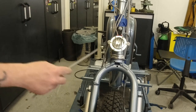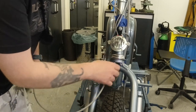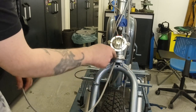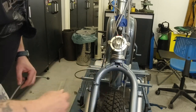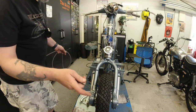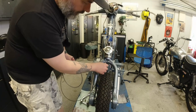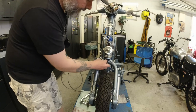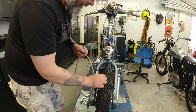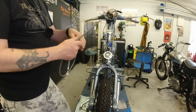The first thing I do is check that the outer actually goes through the hole in the fork, which is here on the leading edge — and yes it does. If it's a bit tight, maybe newly painted, you can put a little needle file in there to open it up. Next job is I thread the inner cable the wrong way around through the hole and up the fork, then balance it on the wheel.